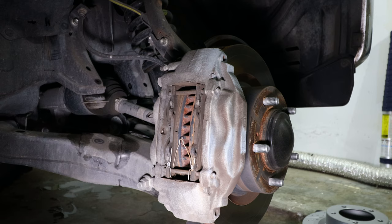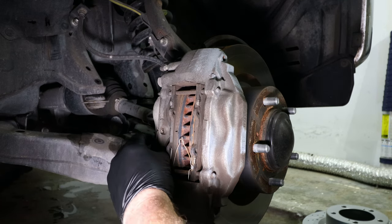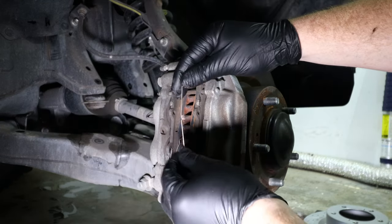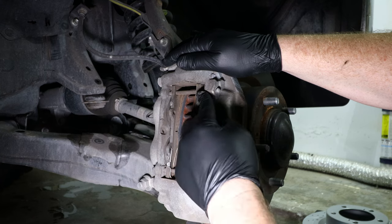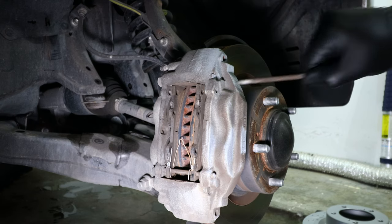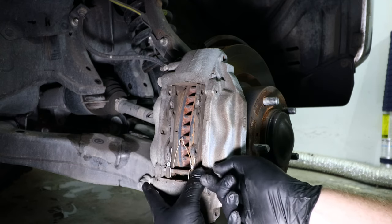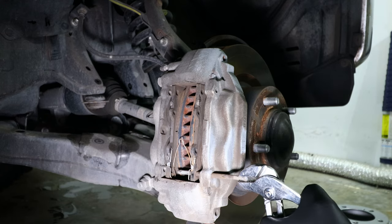The first thing we're going to do is remove the brake pads. In order to do that we first need to take this locking clip off of the backside of the brake caliper — just pull it out by hand, one out of each pin, then the retaining clip is removed. Next we need to remove the pins — there's a top pin and a bottom pin. The top one I can remove by hand. The bottom one might be a little bit harder because it's spring loaded. If you have a hard time you could use some pliers to help pull the retaining pin out.